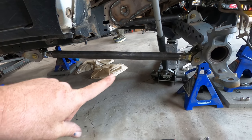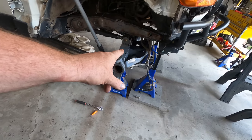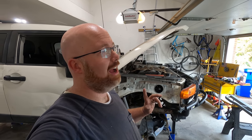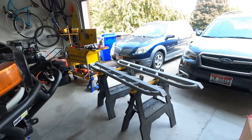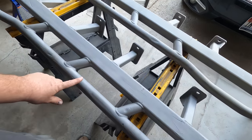Now I've got plenty of room up here where the cat was — basically an inch above the upper link — so the suspension can move. After that's done we can build the exhaust around the suspension rather than trying to build the suspension around the exhaust. With the three links on, I'm ready to move on to the panhard and steering on the front axle, which is going to be a pretty major undertaking and will take more time than I have in this video. So I'm going to close this one out with the reinstallation of my White Knuckle Off-Road rock sliders.